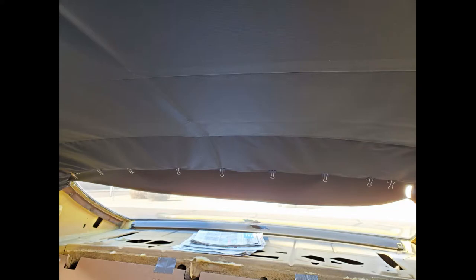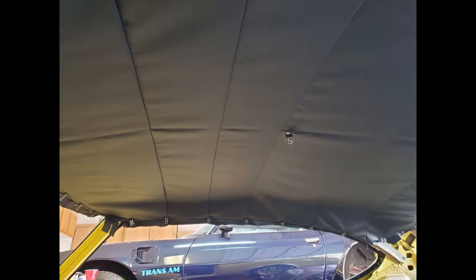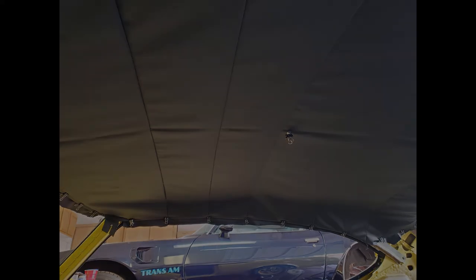I started cutting a few reliefs where I could get it to stretch around the corners. One thing I discovered is I was able to pull the material and get it wrinkle-free, but when I tried to clip it in place the wrinkles would come back. So I felt like once I get the glue down and I'm able to glue the headliner in place where it'll stick and I can move to a different spot, I felt fairly comfortable I was going to be able to get most of the wrinkles out.